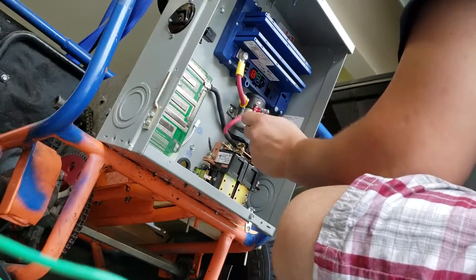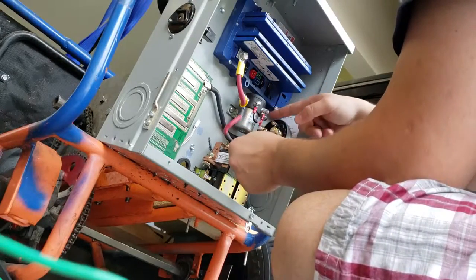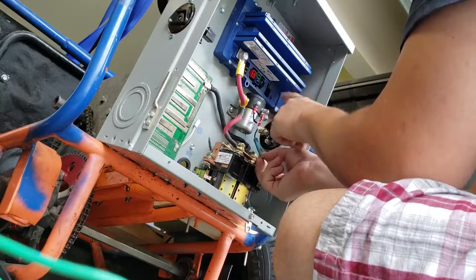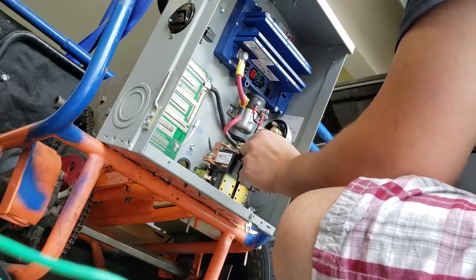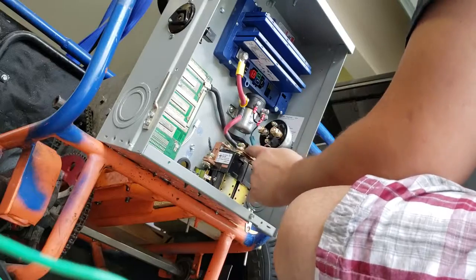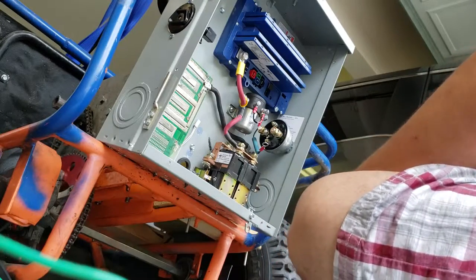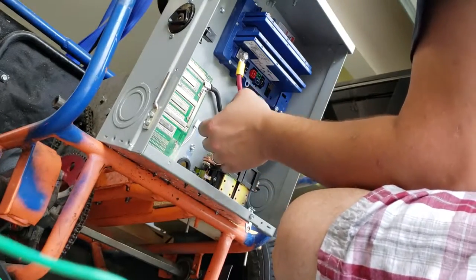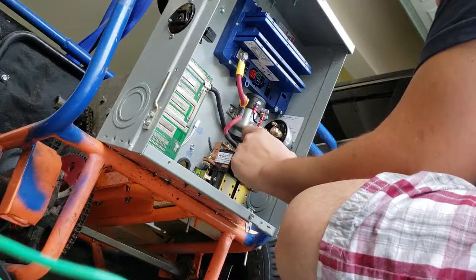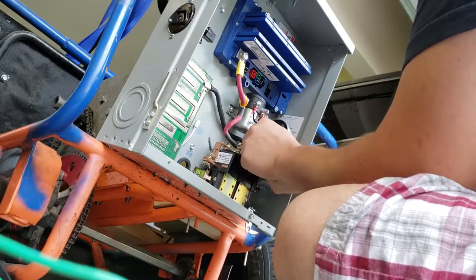You can still turn this by hand if you wanted to, which is kind of scary. This is my resistor. It's going to go from the positive input from the battery or the power source and go to the outside of the output side of this contactor. I'm going to do a cheat here — I'm just going to put it on the wire leading off to my reversing solenoid. That way I don't have to have this hanging across. Same effect — the distance between that is negligible.